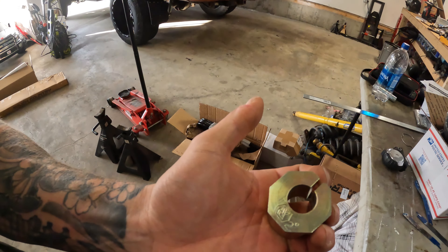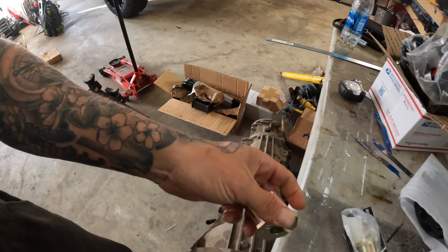Also in this video I did get the Kryptonite bushings — the two-degree caster bushings. That will hopefully get the front end more of a leading axle angle rather than straight up and down, and hopefully fix some of the coil bind since I have the leveling kit. I added a two-inch spacer after the six-inch lift video because of my offsets causing rubbing — they still rub a little bit but way better than before. Okay, let's get this back of the truck lifted up.